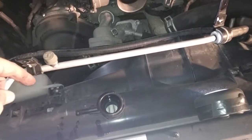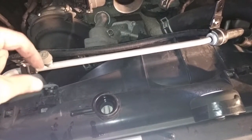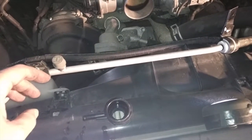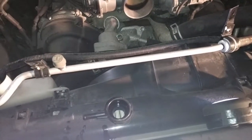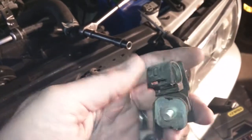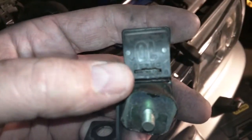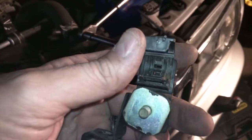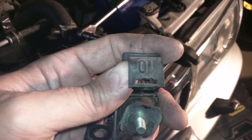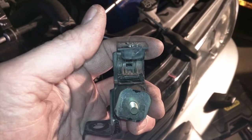And how those worked was I just jammed a screwdriver down in there's a little hole at the top of the clip, and I jammed those down, and pried it out, and then they pop open. Here's what those brackets and that clip looks like. So you can see it just pushes down on the inside there. So I just took a flathead screwdriver and put in there and pried it a bit, and doing that and working it with my finger, I was able to pop these up so they open up again and can be reused.